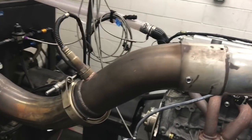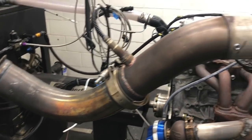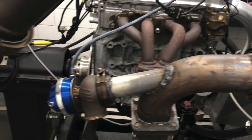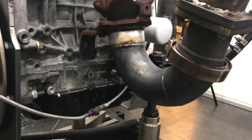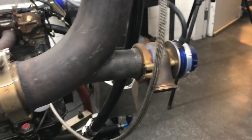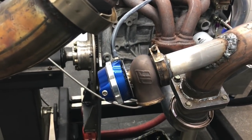Here's our three-inch exhaust. I'd like to put a turbo on here that has something bigger than that. This is a whole conglomeration of stuff — we've got two wastegates on this thing because I ran these elbows from my LS turbo stuff. We've got the factory exhaust manifold on it. These guys welded it up for me, put this elbow on with a series of adapters, and finally the turbo. We have two wastegates with seven-pound springs in them, and we're adjusting with our manual wastegate controller. It seems to be working pretty well.